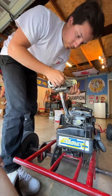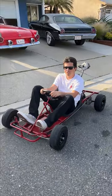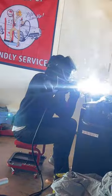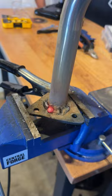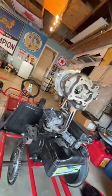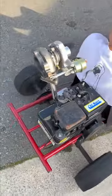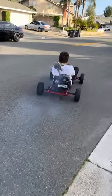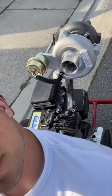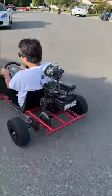Over the last few days I've been making the exhaust pipe for my turbo go-kart and today I'm finally putting it on. I had to re-weld some of the pipe and re-drill the holes to make it fit right, but it's done. Lenny and I connected the turbo to the exhaust hole on the flathead block, started it up, and wow — the turbine actually spins. I drove it around a bit to check for noises. I know it's supposed to be oiled up so I only let it run for about a minute. Now I've got to connect the oil lines and the intake line, but so far so good.